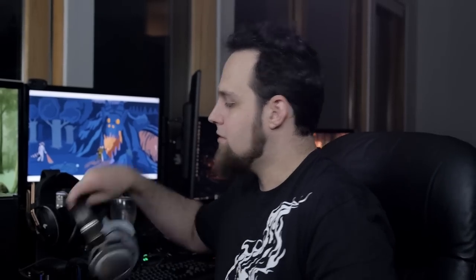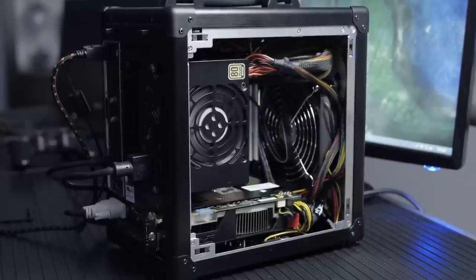There's also decent onboard sound that can power a good set of headphones. I tried it with my Beyerdynamic DT880 Premiums — the 600 ohm version — and it will power those. There's an onboard headphone amp. I also tried it with several 32 ohm headphones and my Sony MDR-7506. The bass is always louder out of every headphone when using the back port versus the front port, so you'll have a much better sound experience using the back port with your headphones than the front port.